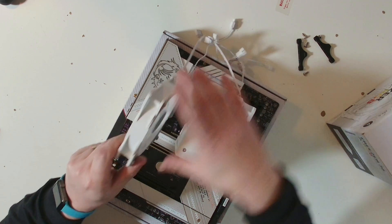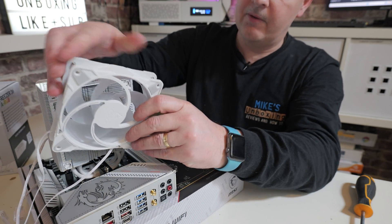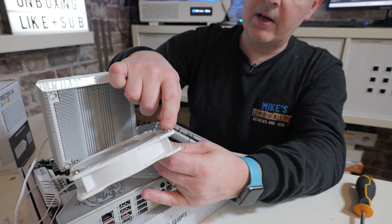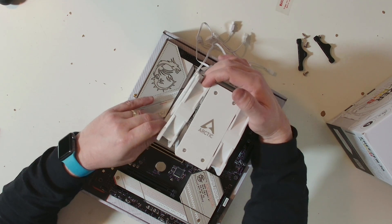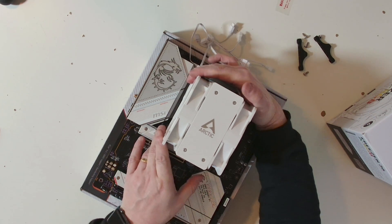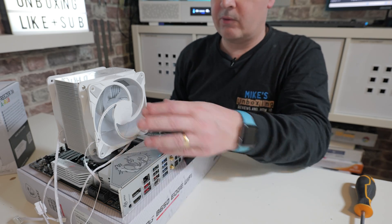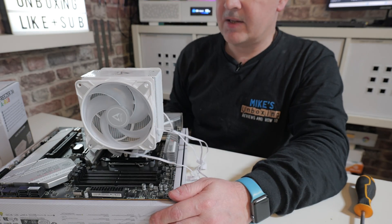With your cables, ideally position one at the bottom and one at the top end so you can route them out the top of your motherboard for cable management. Line up the screws with those little holes — if you get one started at the top, the others just snap into position. So we've got our rear fan blowing outwards towards the exhaust and our front fan for intake.